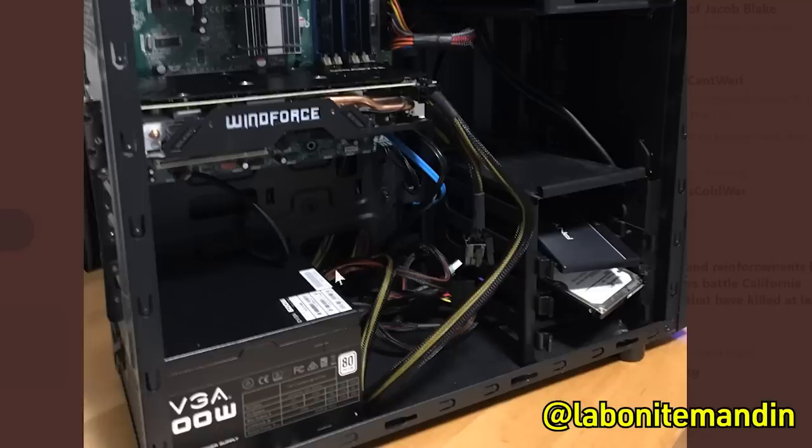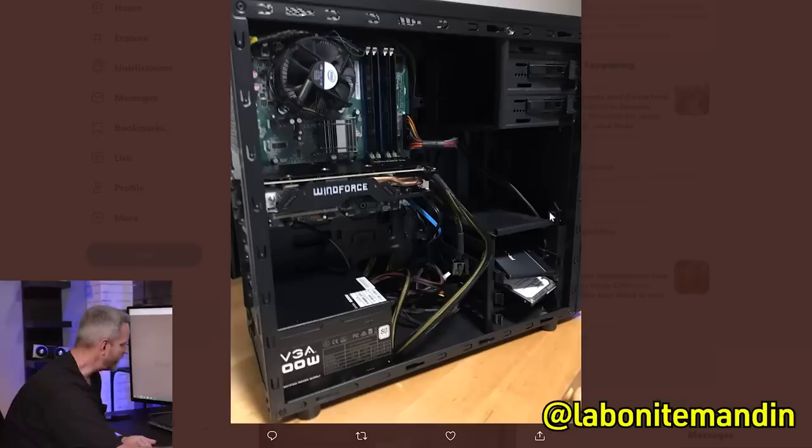You have plenty of reach to not have your power supply cable for your graphics card doing a snaky tour around the inside of your case, terminating into your graphics card. You have enough room to come up through here and come back out cleanly. Same thing with your front panel connectors here. This is your USB 3.0 cable, I'm fairly certain. You've got it coming up, looping, and coming back down, and then into your motherboard right there. I'm assuming this case probably doesn't have an 8-pin opening right here. A lot of older cases don't. That's probably fine right there.